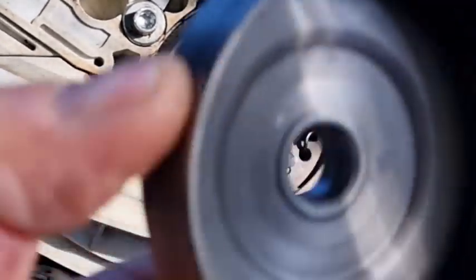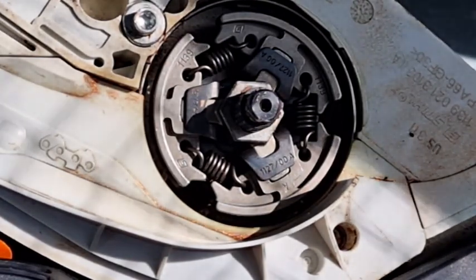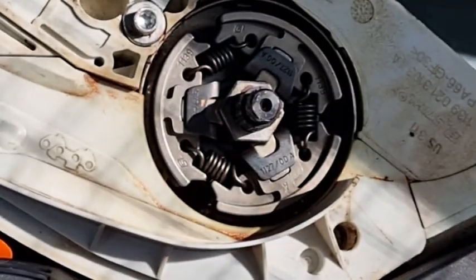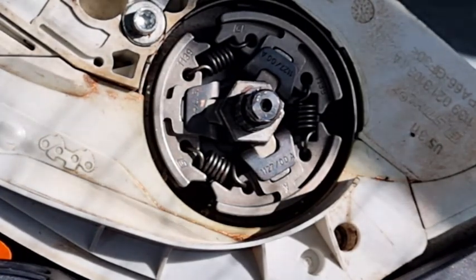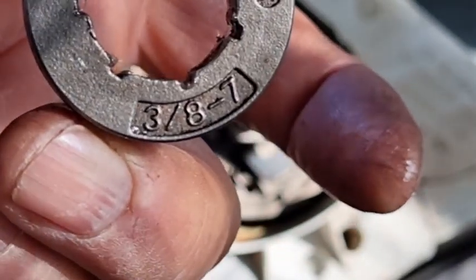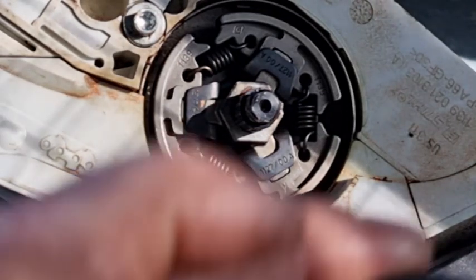Then we do the same to the clutch drum. I'll just take the clutch drum and put a bit of grease on it with a toothpick — you can spread it quite good with a toothpick. Just smooth it around so it's got nice grease on it. Put a little bit of grease on there as well so that the floating drum has a little bit of lubrication. Then we'll just pop that on — you'll see that most of these are stamped, like this one: 3/8, 7 tooth. I normally face that on the outside.